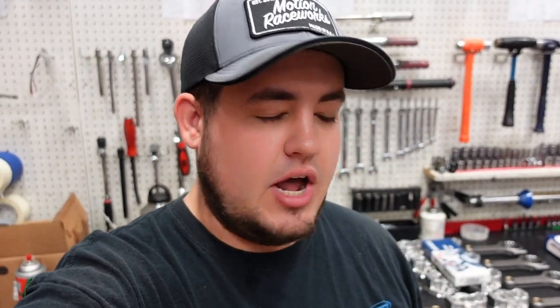What's going on, everybody? This is Shay here with Smedding Performance. What we have for you today is we're going to assemble a 416 cubic inch LS short block, 13-to-1 compression with our 11 degree cylinder head, should make about 700 horsepower naturally aspirated. We're gonna put a little bit of ring gap on this thing because a customer wants to put a little nitrous on this deal. So 13-to-1 compression, not something you could put pump gas in.